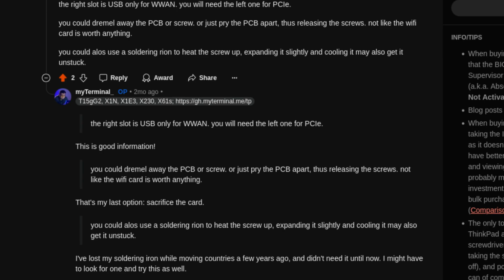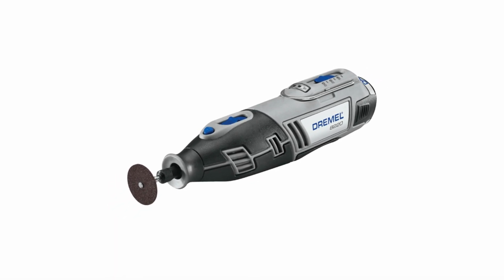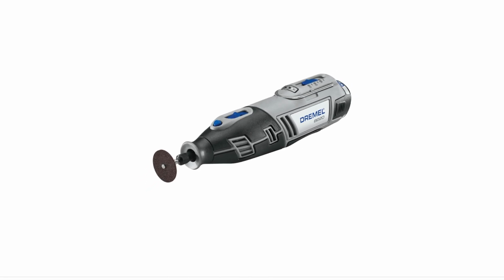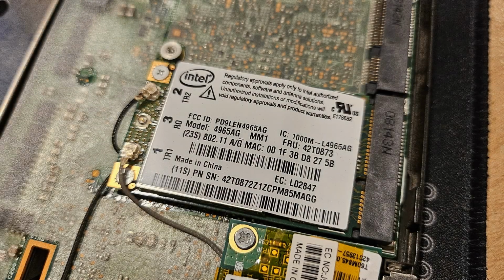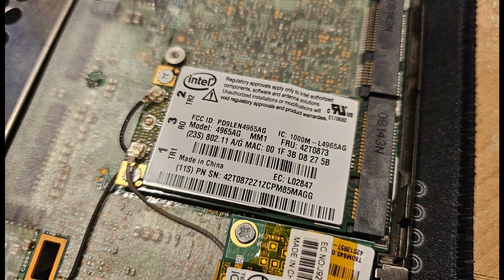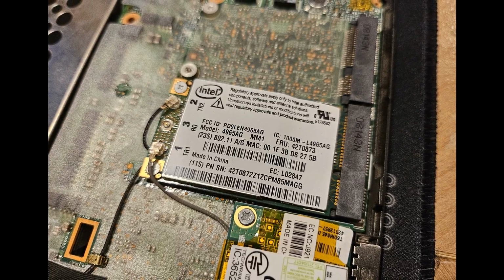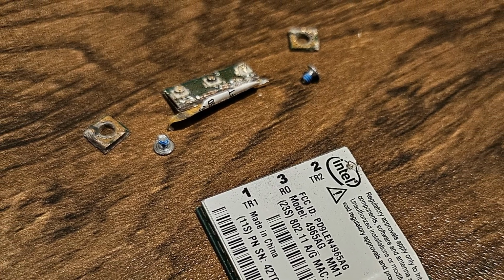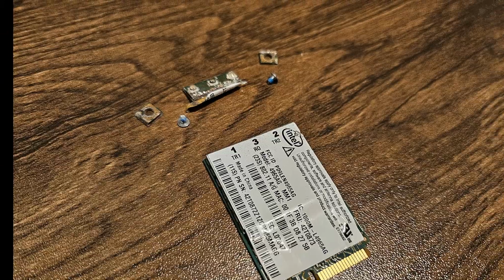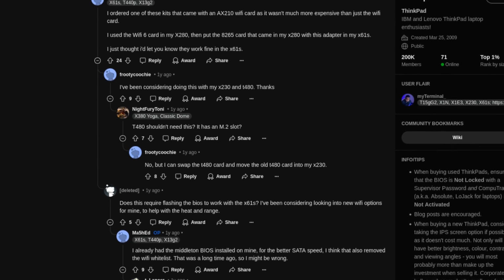I wanted to make sure the screw holes on the motherboard were in no way affected, so I used a Dremel tool and a utility blade to systematically cut the circuit board out, also making sure I extracted the screws without leaving any residue, so the new wireless card could be installed without any trouble. The entire process was violent and needed extra care to not damage the motherboard, not spraying metal dust all over it either, and yet getting it out as cleanly as possible. It came out in 4 pieces, exactly as planned. I lost a fully functional Wi-Fi card that day, but that sadness was overcome by the excitement that a new and more efficient module was going to take its place soon.